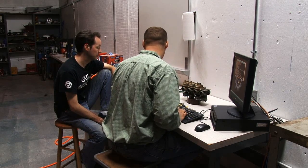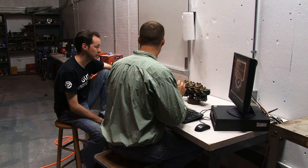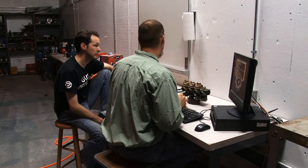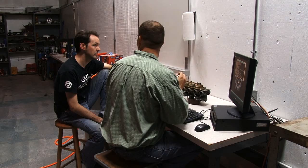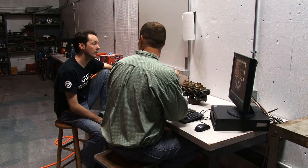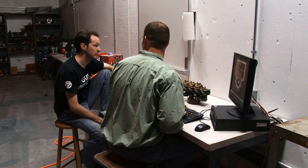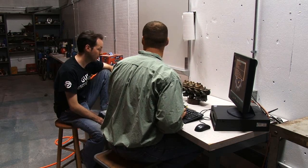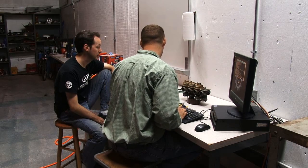Okay. And this is brass, so if you ever feel the urge to go through and clean out the inside, say you don't have a carb kit or there's not a carb kit available, you can use soft copper wire to poke through and clean it out. That's kind of a hackish way to do it. But it works. Roadside repair, you do what you got to do. That's just how it goes sometimes.